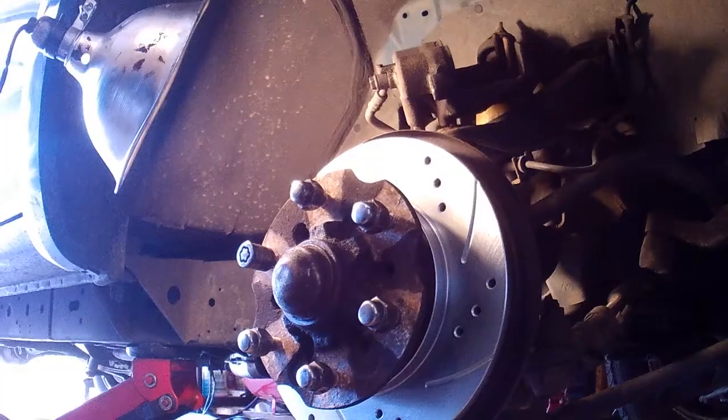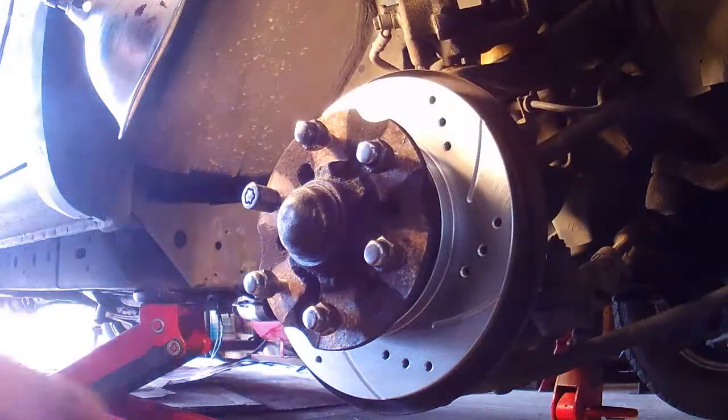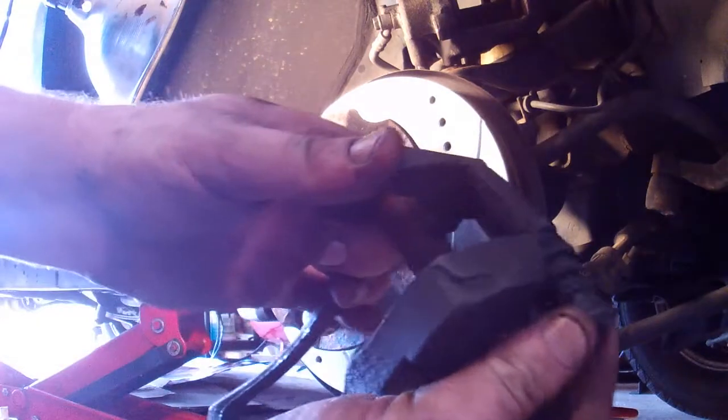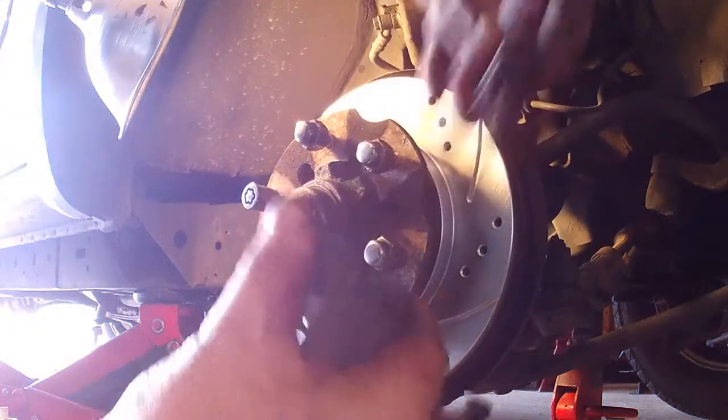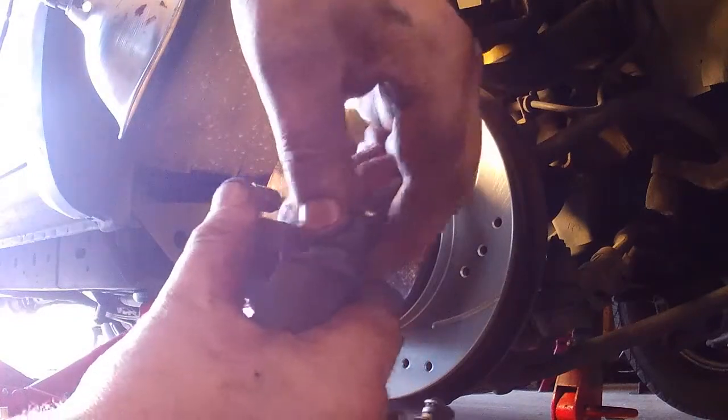This acetone will smell up a garage. Boom — we're fixed! Only took me an hour. I fixed both of these caliper slide pins — they're moving and greased. I took the rubber seals off, put fresh grease in them, and they turned nice and easy. No more worries.